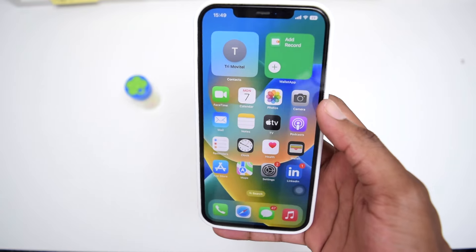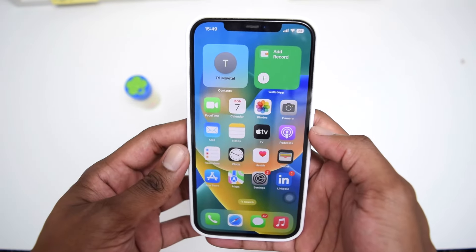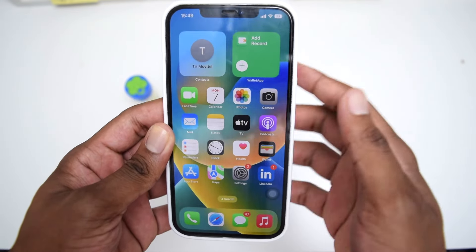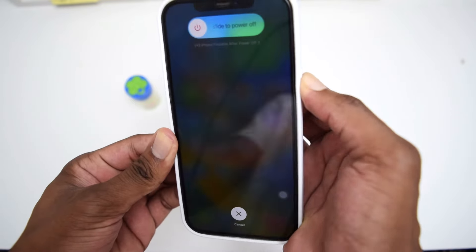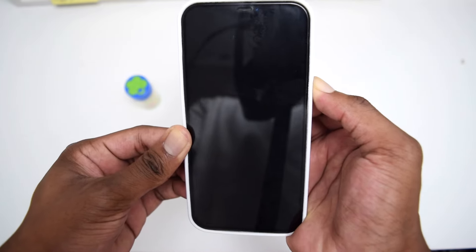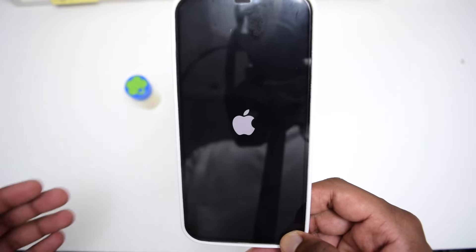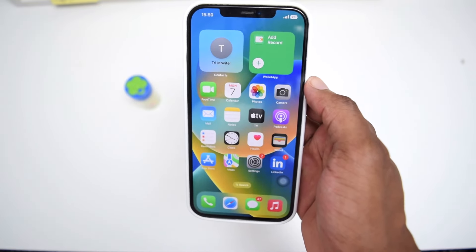If you've got any iPhone device above iPhone 7 Plus — for example, iPhone 8, 10, 11, 12, 13, or 14 — you need to quickly tap and release the volume up button, then press and release the volume down button, and then press and hold the power button until you see the Apple logo on your screen. Do not release the power button; keep pressing it until the Apple logo appears. Once you see the Apple logo, release the power button and let your iPhone reboot. Once your iPhone has turned on, simply unlock your phone and test your speakers to see if they sound better.